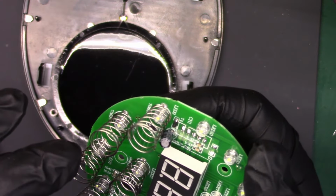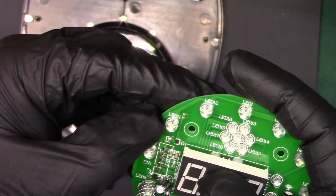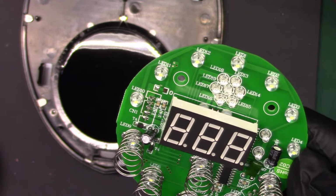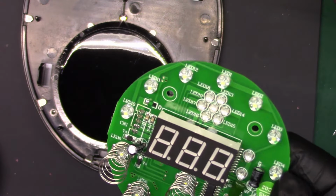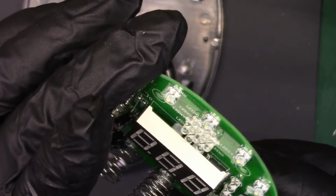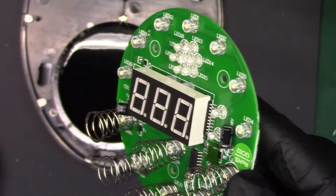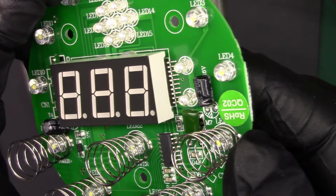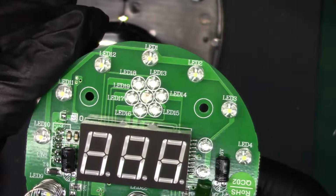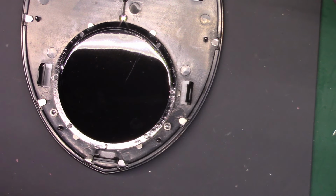You have some hand soldering on the connector that goes through. And it looks like an update in the board design where they used to have a resistor and then they just drew a line. They bridged it. Let's see, oh, there's the thermistor input, CN2. So CN2 has one wire that runs all the way up through a resistor, through a 0 ohm resistor, so essentially through a jumper, and then into that chip underneath. So that's the brain, that's the microcontroller in there. We'll just have to pretend we know what it is, or if you know what it is, put it in the description. Let's put this back together now and get this thing making some food.